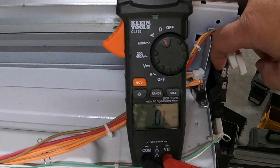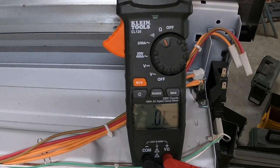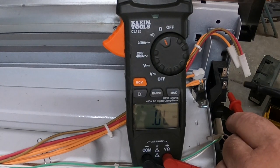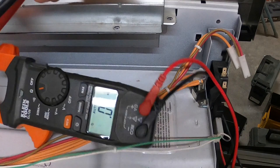There can be two-wire switches where instead of the bottom terminal there's a terminal up top — that's the normally closed terminal. And there can be switches that have all three terminals. This middle terminal is always your common. You're always going to check from the common to the other terminals, and you can open the door or drawer to actuate the switches.